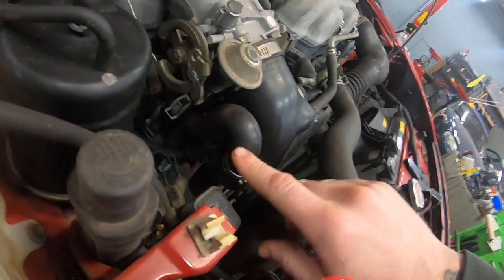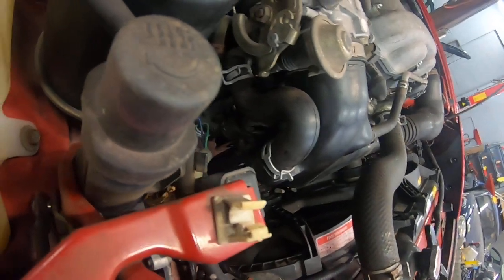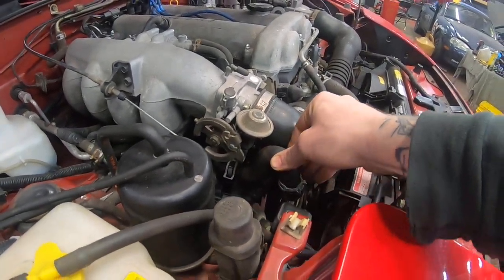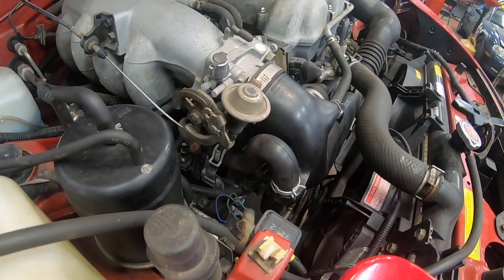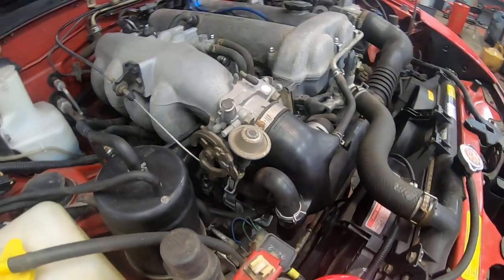There's a little S-shaped tube here that's very important — it goes down to the idle air controller and connects to the bottom side of the throttle body, just like most Miatas. If this tube gets cracks or someone forgets to connect it, it causes your Miata to not run well at idle because it's pulling in unmetered air.